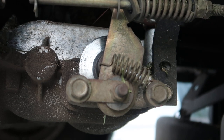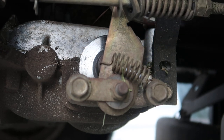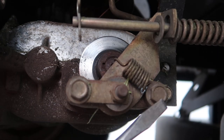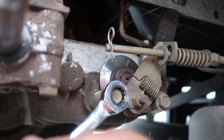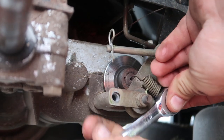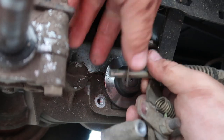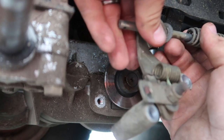This is what it looks like when you press the brake on the lawnmower and what actually happens behind the wheel. To remove this brake assembly, go ahead and remove these two half-inch bolts — they go in from the front all the way to the rear. Once you have both bolts removed from the brake assembly, pull the cotter pin out of the shaft, remove the washer from the shaft itself, and slide the brake assembly away from the shaft.